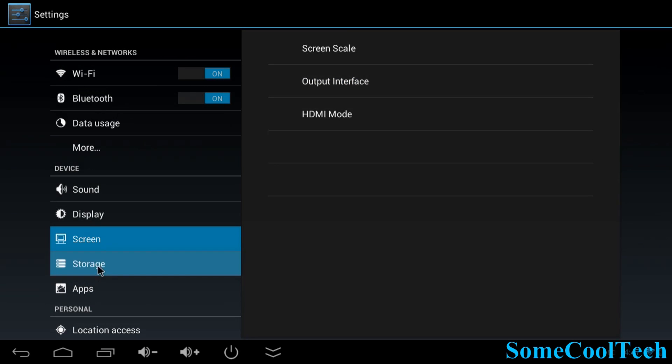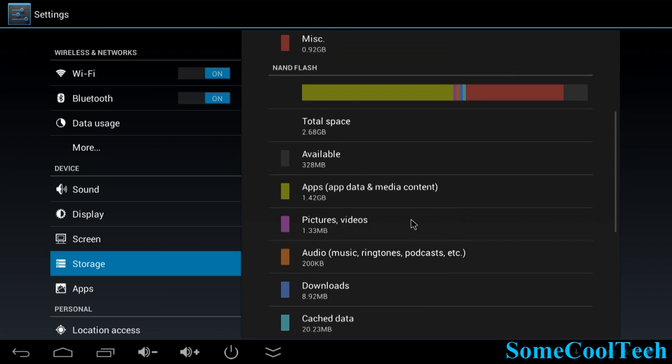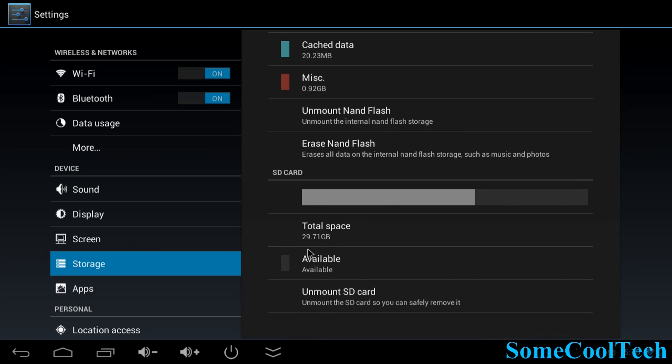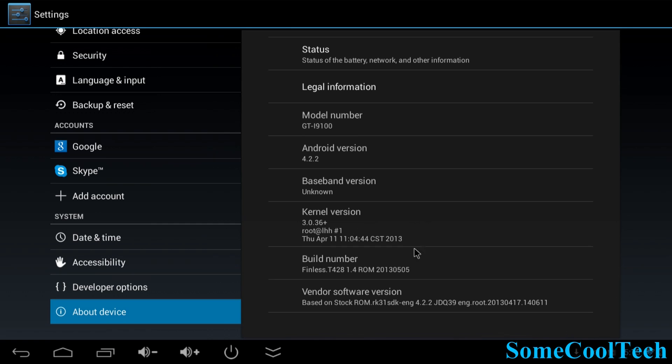For storage, during the install of the Finless ROM I upgraded from 500 megabytes to 4 gigabytes of app storage, leaving 2.6 gigabytes of data storage, plus I have a 32GB microSD card for more. I'll put a link to the upgrade video in the description below. The software is Android 4.2.2 on the Finless ROM. If you have another 4.2 device you can do mirroring, though it has to be a supported device — the Nexus 7 doesn't support it right now.